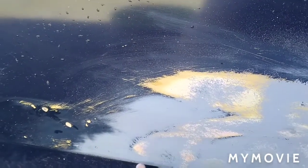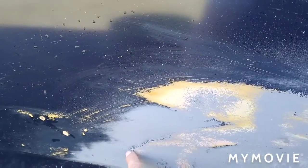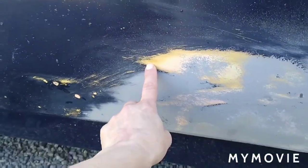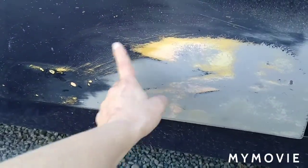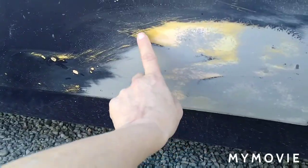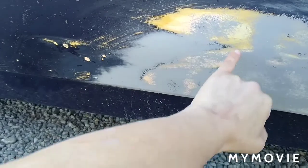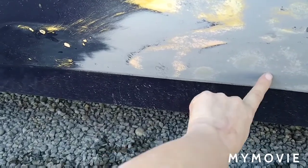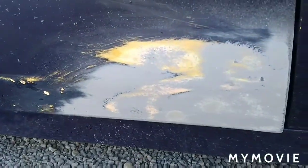You've got the paint underneath. The yellow here is acrylic primer - it's definitely acrylic on this car. And so you've got that, you've got the pink, and that bluey colour there - that is bog. And this under here is bog, so it hasn't got much primer on top. I would say that's just a bit of a can primer.